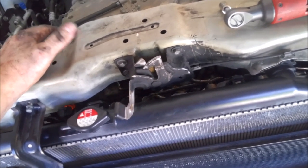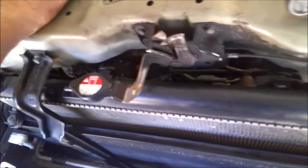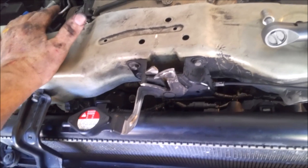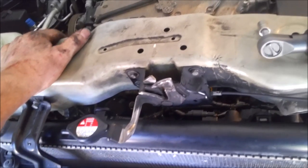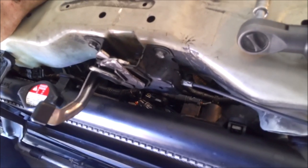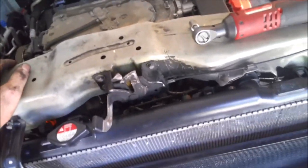It's a not-too-bad job. If you get the right catalytic converter and you're somewhat skilled, you should be able to do it in two to three hours. Once you start taking things apart it opens up and it's pretty easy. Definitely put some cardboard by your radiator when you pull that converter out so you don't damage it. Good luck if you get an aftermarket converter — this one is from Napa, part number 16658. That's the bank two catalytic converter for a Honda Pilot. If you got a 2012 and you're going to go aftermarket, go to Napa — that's the only one I found that worked. Everyone else either had it on order or it just didn't seem right. This was a perfect bolt-up and went real smooth once I got the right one. I've got some more Hondas coming in later this week, so we'll see you on the next one. We'll get this buttoned the rest of the way back up and get this thing back on the road. Thanks for watching.